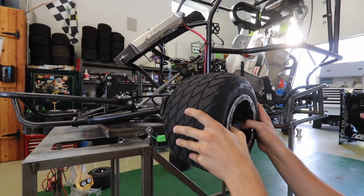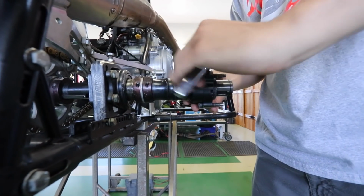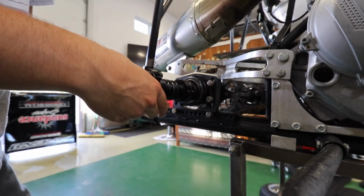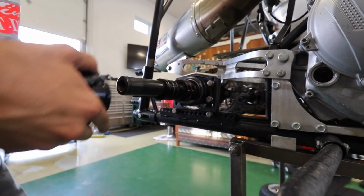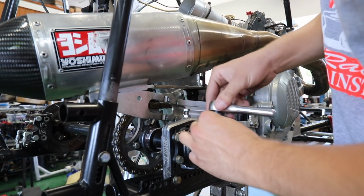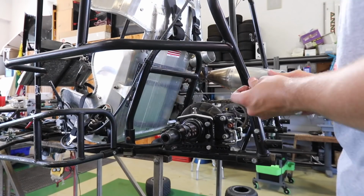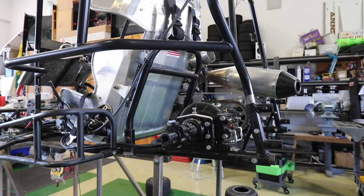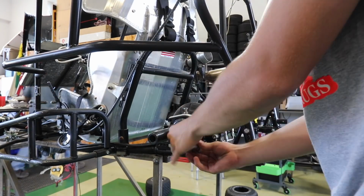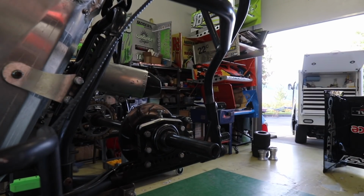So now that we got all 4 tires off the 18T, it is time for our first project, which is to maintenance our bearings we have here in our rear axle. Now these are specifically in the axle hanger, so in order to get to them, we have to take off the hubs, then also the wheel spacers, and then we have to loosen these 2 clamps which we have on the rear axle so it can't slide from left to right and we can set it in the exact spot. Now everything in this process is ×2 because you have the left rear and the right rear. So once we get all this off, then we can officially start maintaining the bearings themselves.